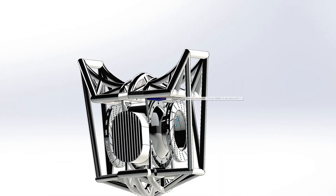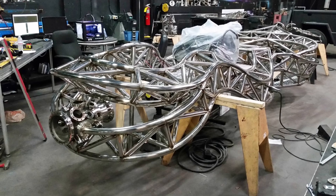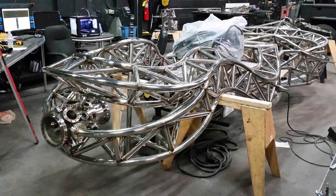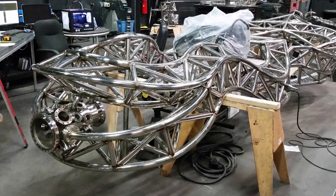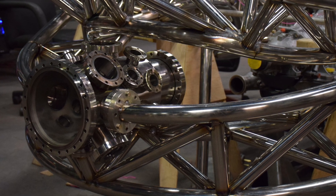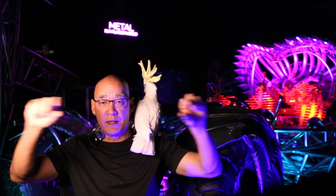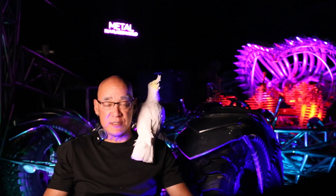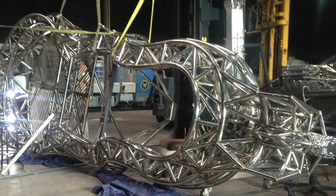Once we got the differential cradle fabricated, it just had to be attached to the frame. And here you see in the frame that it's got this vacuum chamber that interrupts the truss. The reason I had to do that was the drive shaft is about four inches in diameter, and there just really wasn't enough room for it to fit through the trussing. So I needed something that would interrupt the truss and still be strong and beautiful. The drive shaft goes from the transmission through the vacuum chamber and through the truss, attaching to the rear differential. From the rear differential, there are two axles that go to the side for independent rear suspension. Unlike a solid axle vehicle, the differential does not travel with the wheels as they move up and down — it's bolted solidly into the differential cradle, which is bolted to the frame, making it part of the frame.